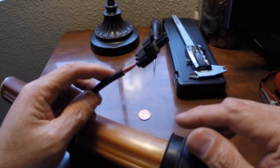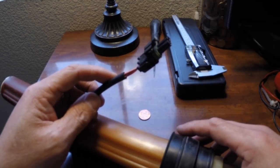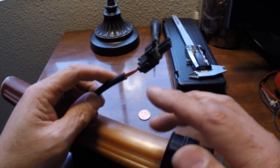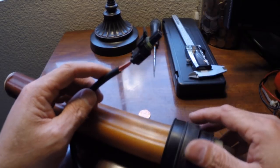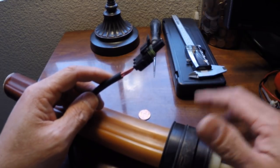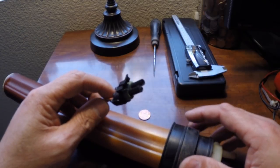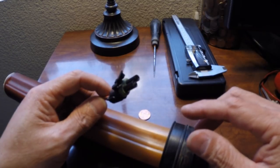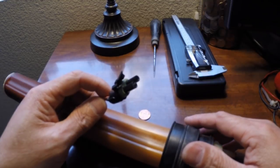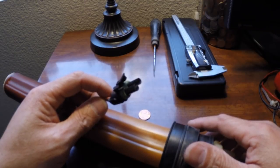If that's not the issue, the other thing probably causing your gas gauge not to work is the float itself — maybe it's full of fuel and no longer floating. This sending unit has been sitting a couple of days, but I already dissected it, checked the float, and made sure it's not full of fuel. For this video, I'm going to go through it again to show you what needs to be done. Start with the easy fix — check your wires. Next, check your floats. The third thing to check is the magnets — maybe they're no longer attached to the float.